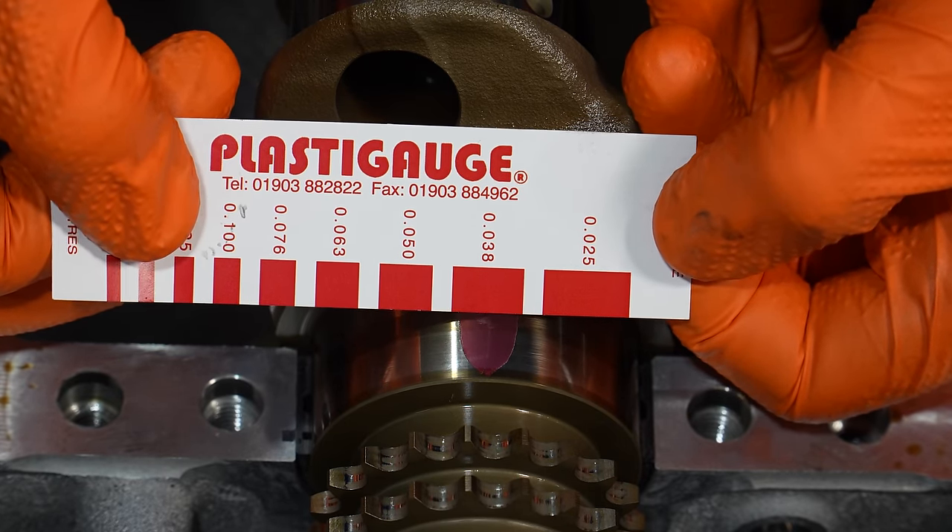On a more traditional engine we'd have individual main bearing caps and a standard metal-rubber gasket to seal the upper oil pan, but this is a bed plate design — essentially one piece block chopped in the factory. The bed plate comes on top, meaning there's no standard gasket. Instead we first torque the bed plate down fully, install the front and rear crank seals, then inject a special Loctite sealant through ports on the sides to fill this channel and create a permanent seal. You only get one shot at this.